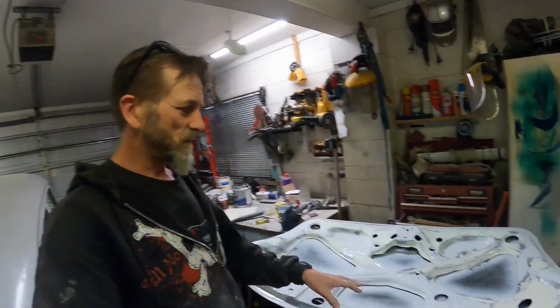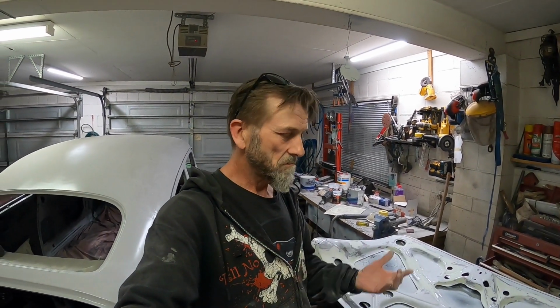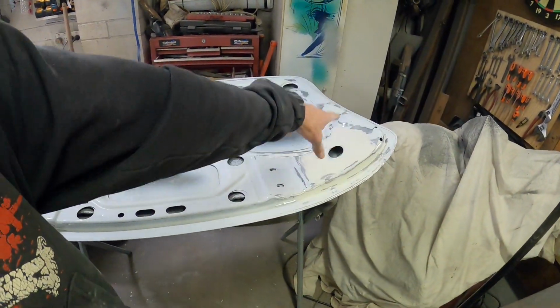So I'll go and do that and then make a decision on whether I put some more of this epoxy on here or seal that up again, or whether I chuck some of the high build on there. High build's going to go on there eventually anyway, and it will end up sitting for a few months, but at least that way if I epoxy it, the bare metal will be sealed. Know what I'm saying? Yeah, I'll go and do some reading.